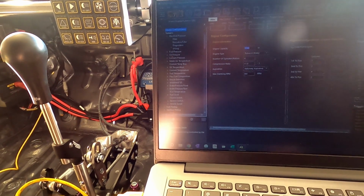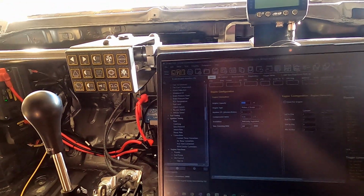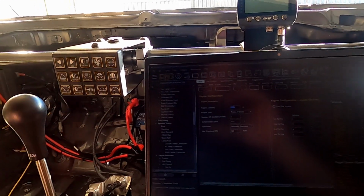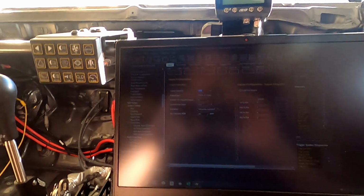There's lots in there. Set up the fuel pump outputs. I've got two fuel pumps. I've got a lift pump in the main tank behind me and then a surge pump in the engine bay. Gave those an override button so I can turn those on when the car's not running, for things like getting 98 out of the tank so I can fill it up with the 85.